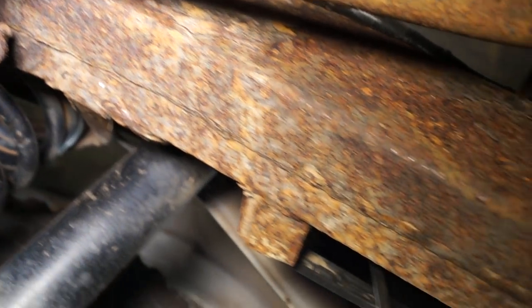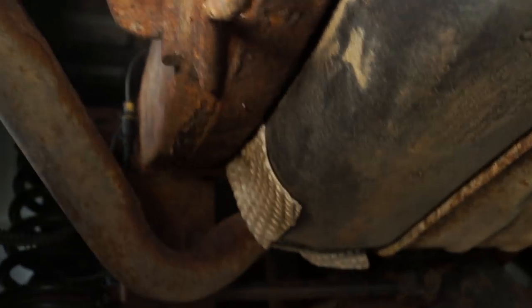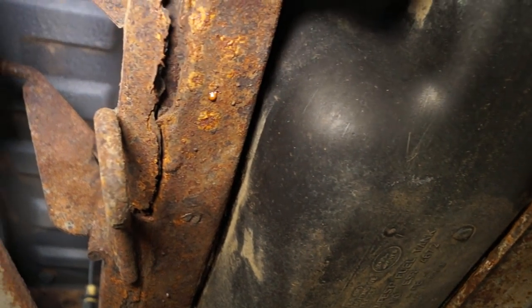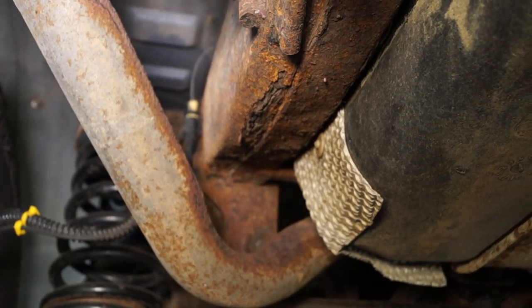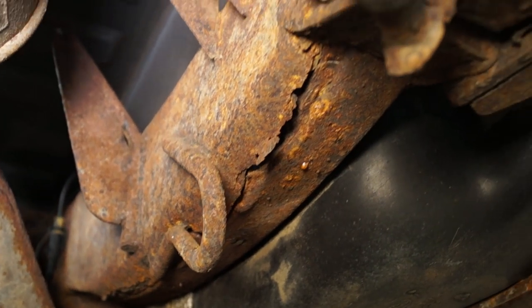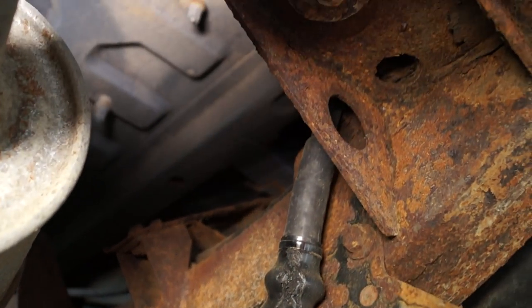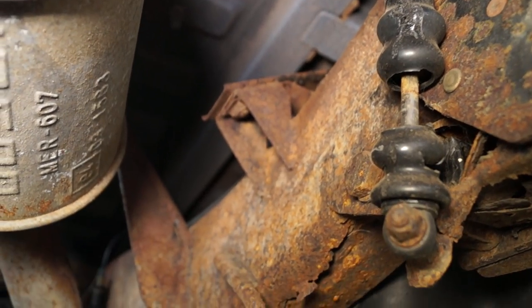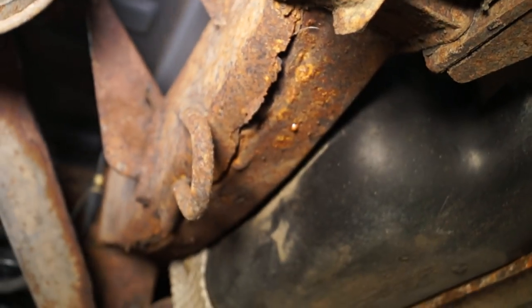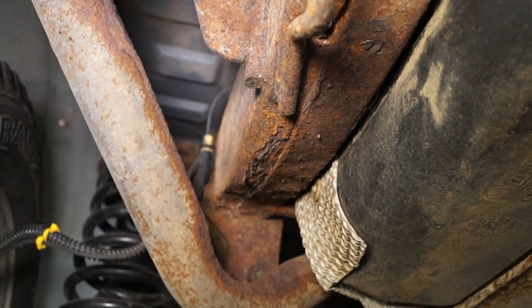This chassis is rusty. I steam cleaned it last year, and it's been stood up since then. That's mainly surfaced rust further down. On the rear end, she's burst through the seams here. The rear end is always worse than what it looks, and that'll be most of that at the bottom end. I can imagine where the tank is, that'll be rotten too. I'm going to cut this bit off the vehicle and redesign it — I'm going to cut this and remove most of the bodywork. She's a rusty old mess, and most D2s are, because the chassis weren't really rust-treated very well.